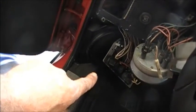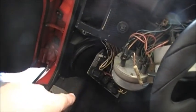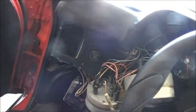Those two bolts inside the bezel are probably the hardest to get to. You can get them through the front through the bezel, but you're going to have to bend your wrist and almost be a contortionist. Probably the easiest way is with a long extension going in from below the dash. You're also going to have to remove your fuse panel. And obviously, you should disconnect the battery before starting any of this work — you don't want to short anything out and have to replace all the electrical wires.